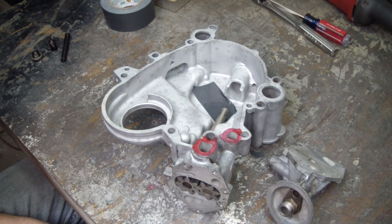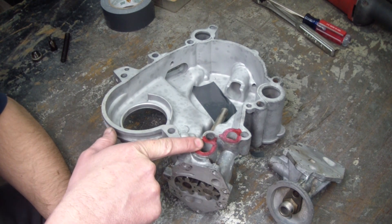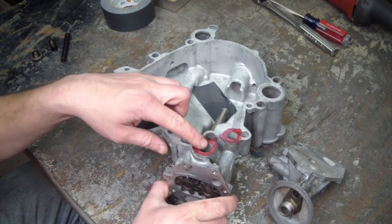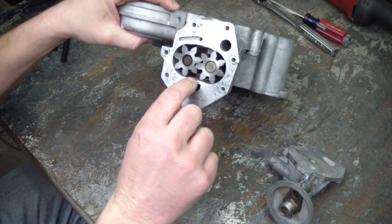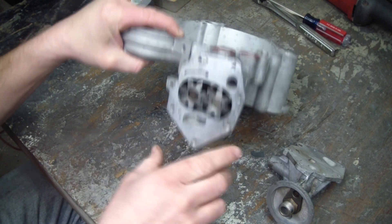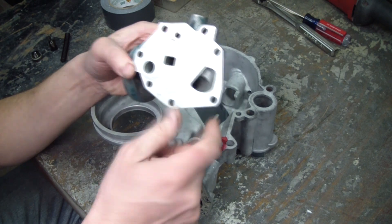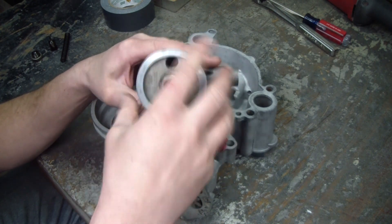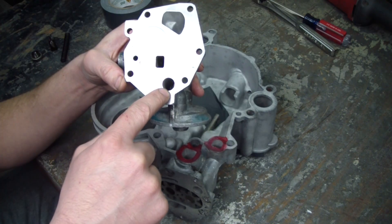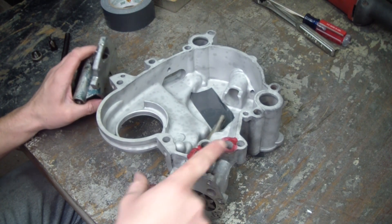Basically there's a pickup in the sump of your oil pan that picks up the oil. It goes into the block through a passage, and from that passage it enters into the timing chain cover right here. From here it goes into the actual pump housing. Then there's a hole down there and it goes to the high pressure side here. From there it goes through your oil filter housing, follows this channel here, gets filtered, exits here. That connects to this hole here which is mated to this hole, and that goes to here. Then it feeds the block.